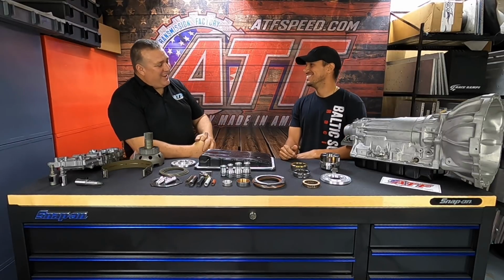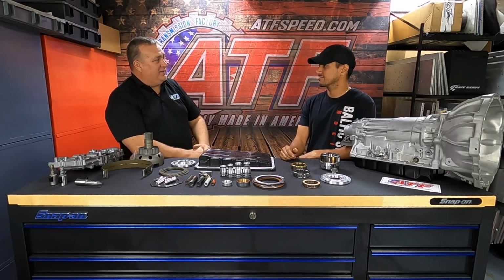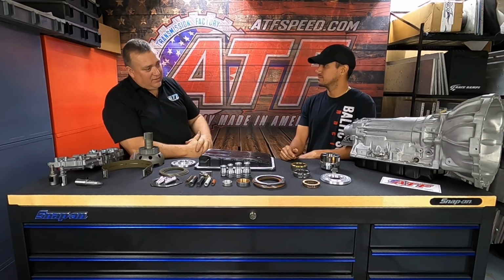I see. So if you're beating on your car and it's running through the radiator, and you're making a couple passes, it'll stay far more consistent. You know, racing out in Mexico, in the middle of the night, you can pull over and let it idle for like 1 or 2 minutes, and the tranny temp will come right back down, and then you can shut the car off and give it 15-30 minutes or something like that, and then do it all over again.